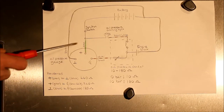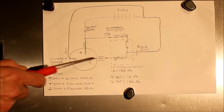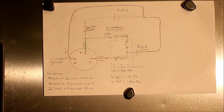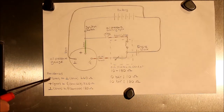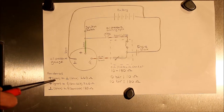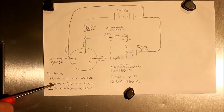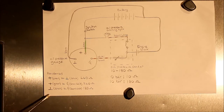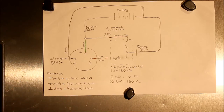For testing, we need to check we've got 12-volt power coming into the gauge when the ignition is on, and then measure how the resistance through the pressure sender changes as we increase engine speed and oil pressure. If you want to check whether your gauge itself is working, here are the resistances from a known good gauge: between the plus terminal (green wire) and earth terminal (black wire) — 440 ohms; between the plus terminal and terminal G (brown and white sender wire) — 260 ohms; between the earth terminal and terminal G — 180 ohms.